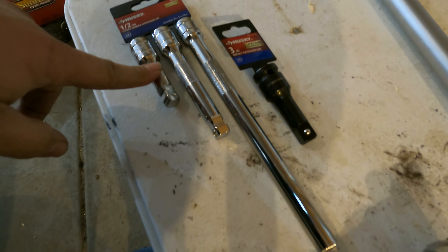Another milestone moment. This comes off of here, and once that nut comes off - which actually turned out fairly decent - a couple little hammer strikes on this right here and it popped loose real nice. I've got my three bolts out. If I had to do it over I probably would have left one nut barely hanging on the front because now I've got the steering control arm off. The nut came off fairly well, then a few hammer strikes - not too bad.